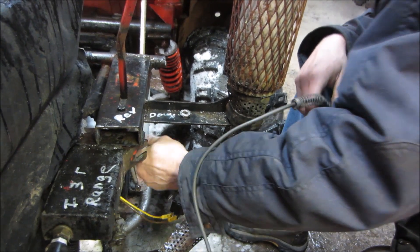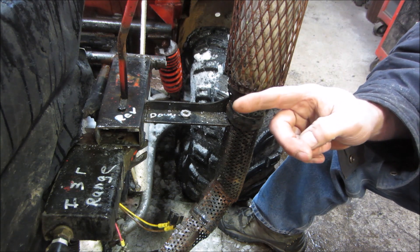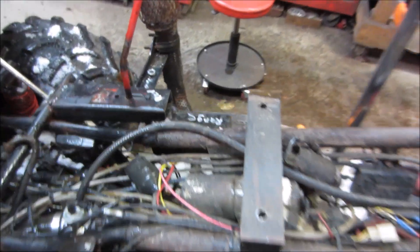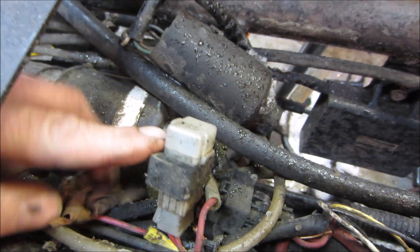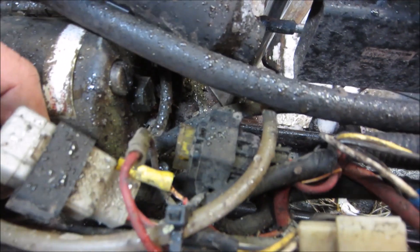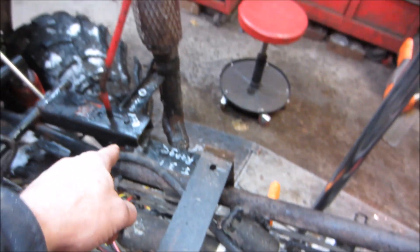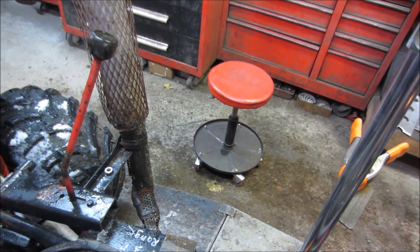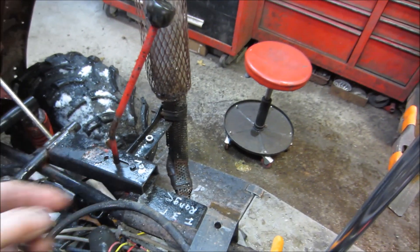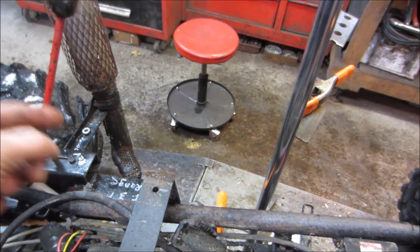So it's more than the switch — I do know the switch is bad too though. Let me get the top of the seat off because we're going to want to get in there for the pump anyway and we'll see where that wire got lost. I popped that seat off — which color wire are we looking for? This one. We want to see where it gave up the ghost. Could be that guy — could be the fact that that guy and that guy aren't connected. You know what happened? The switch got ripped out and was kind of rubbing on the tire a little bit when I was trail riding, and I have a feeling it just yanked on it. That was an easy find. We'll patch that and get a new switch over there.